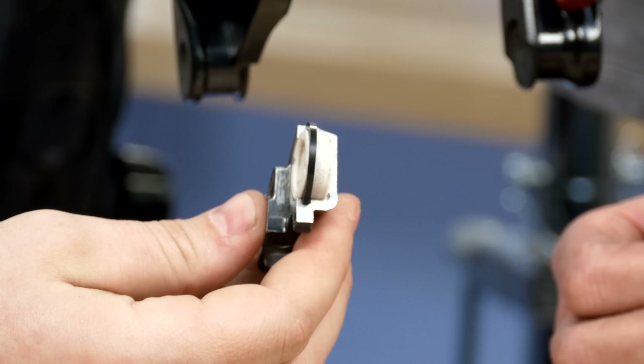My hand is going to be the piston moving in the bore here; this is going to be the seal. As the piston advances forward, the seal is going to flex. That flex allows the seal to actually pull the piston back — we're calling it rollback. This is advancing, and then as your pads thin, your piston needs to advance further. So your seal will reach its maximum amount of flex, and then the piston will slip and take up the amount needed for the wear of the pad.